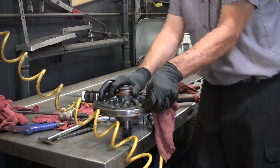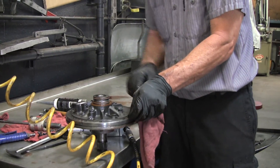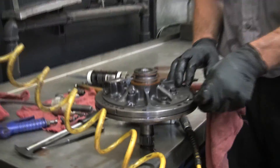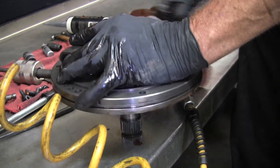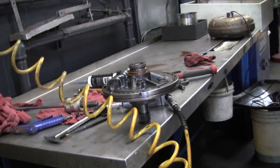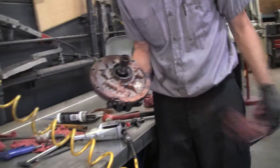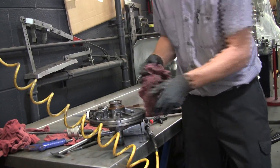There's a lot of holes in here. You've got to put it back on the right way, obviously, because all these extra holes — not bolt holes — are fluid passages. Make sure they line up. To be honest with you, if all the bolts go in the holes, you've got it lined up, because as you can see, they were not symmetrical in any way. Another smart thing from GM.